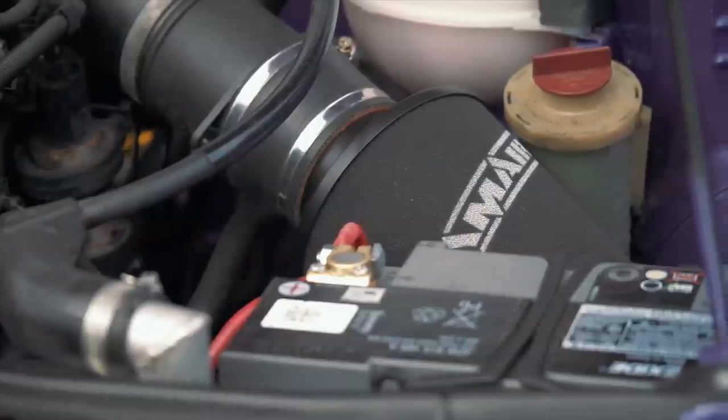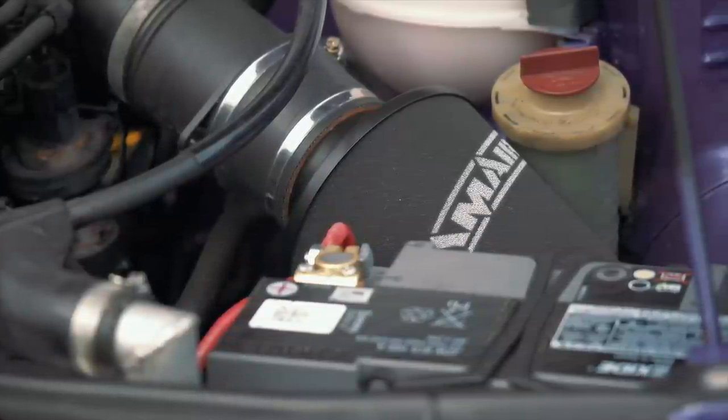Oh, seriously? So it literally is a VR6 engine? Yeah. Nothing different? All it is that the cylinders are at a 15 degree angle to each other. Okay. So it's like a bent straight six, if you will. But is this engine from a VR6 or from an R32? It's from a TT, Audi TT. Still a 3.2. Oh, jeez. Yeah, I actually went for the TT one because it kicks out a bit more power from factory than an R32. All right. An extra 10 brake, so.